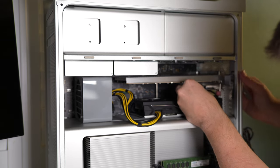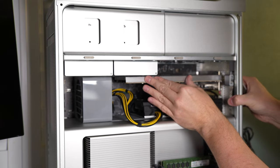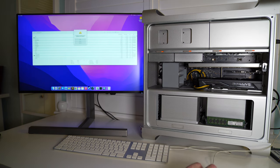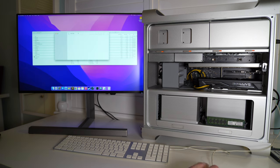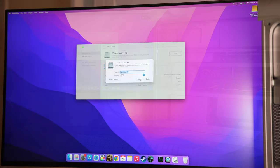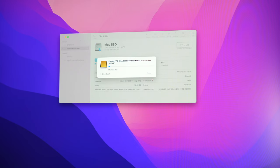It's a bit of an ongoing quandary: you get better speeds from x16 but slower from x4. Using the x16 slot, the card is basically touching the graphics card and clipping the fans. Anyway, with everything installed and the computer turned back on, I went straight into speed tests. First I tested the big old HDD — the SATA 2 limit is 300 megabytes per second so I wasn't expecting massive speeds.